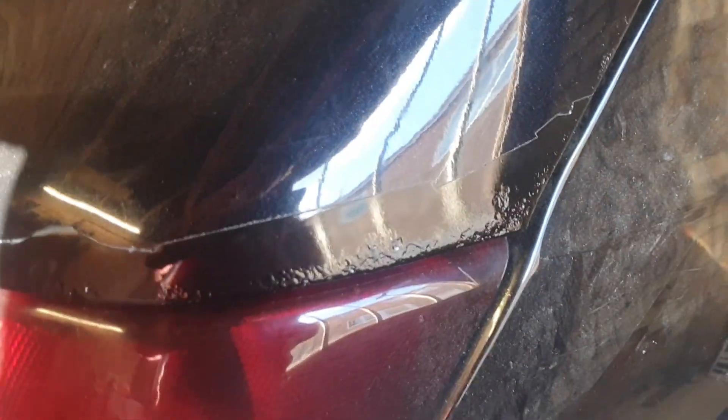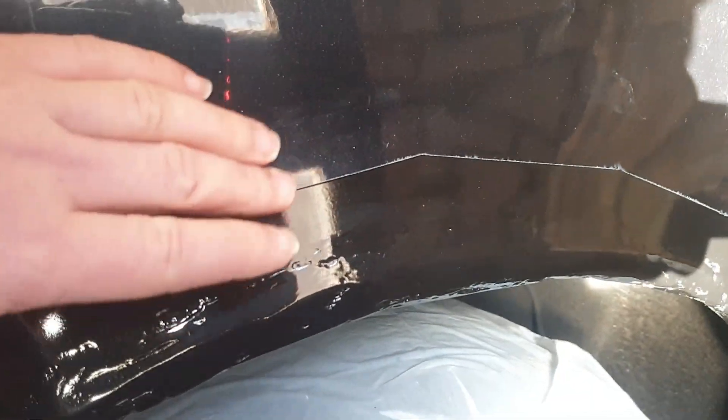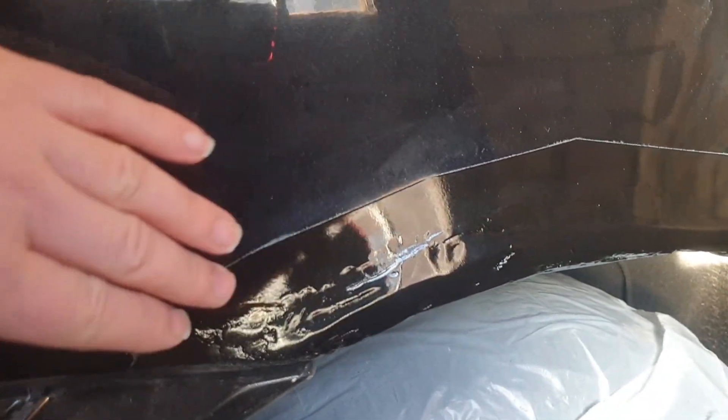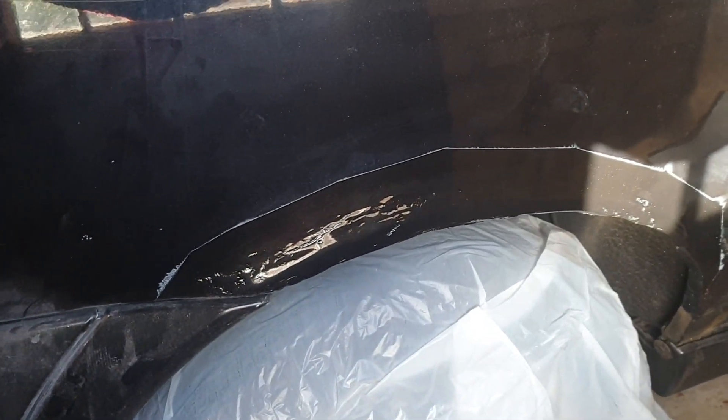So there it is. As you can see it's got the pearls in the paint quite nicely, but there is quite an apparent change where you can see this big step where it goes back to the standard body. But I think with some 1500 grit and clear coat we can maybe blend this in a bit better. All in all compared to what it used to look like, it's a considerable amount better - you've just got to blend the new paint in to match up with the old paint. That is it for this part - if you enjoy the video please don't forget to like, subscribe, and maybe even hit that bell icon for notifications, but until the next time guys.